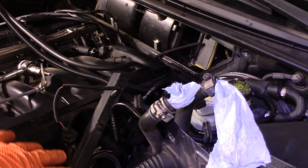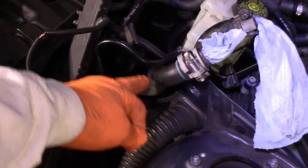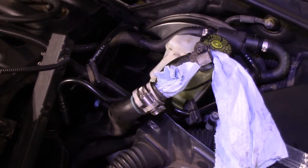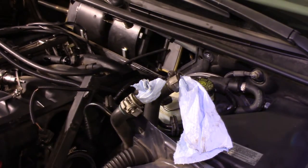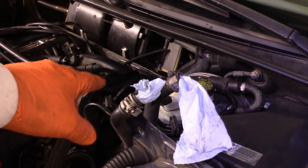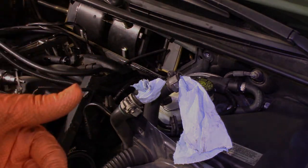Those are the major things. There's also a plastic piece right here that covers part of the engine — go ahead and lift that out, it just gives you more room to get your hands in and work on everything. Like I said, this is about trying to replace those silly vacuum hoses back there that I worked on for hours and finally realized you can't do it unless you take off the heater hoses, because you've got to get the brace back there off enough to be able to push on your hoses.